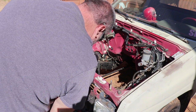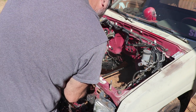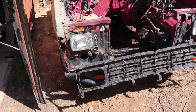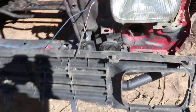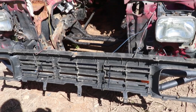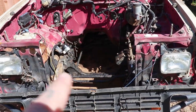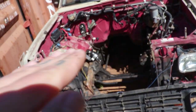I dropped the bumper that I made down and just dropped the grill down and zip tied it as well. I did not want to take those off because I've got wires running to the turn signals in those LED lights. I didn't feel like unwiring those if we don't have to. Cut the center core support out right here so we've got more room to get the motor through — instead of having to come down and in, we can do more of a straight forward angle in.